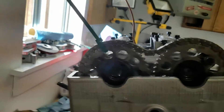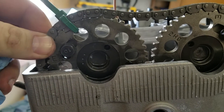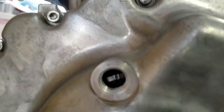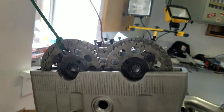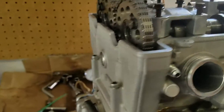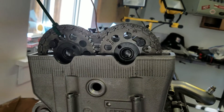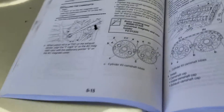The zip tie is once I have the intake cam wound up — as you can see the marks — the tension is in the right place on the chain, they're straight. See in here, I'm on the eye mark. So now I'm setting the intake cam while having this clamped down. I'll snug these up, these bolts for the caps, verify that with the tensioner slightly snug that everything is in the right place. You got these to refer to, the bolts to refer to, and see how it shows you to line it up in the manual.